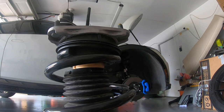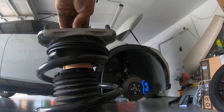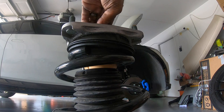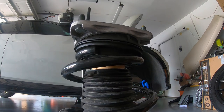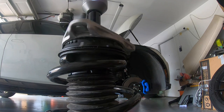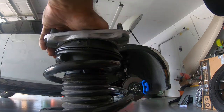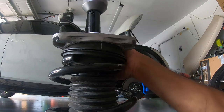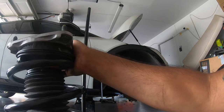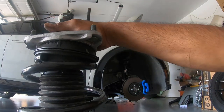You can adjust the yellow piece later on. I'll put the dust boot on after I tighten the nut at the top. Then you start the nut at the top with your hand, making sure everything's still lining up properly. Take your impact. It looks like it's all the way in — I'm going to double check. Yep, everything looks good. Everything is still aligned — that's aligned up there, that's aligned down there. Now starts the act of putting it back together.